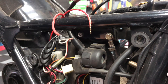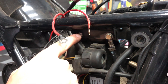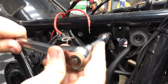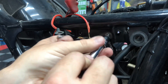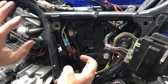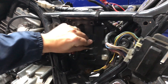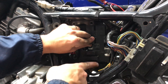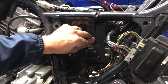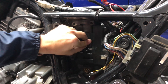Here's what the other side of the battery box looks like. There's this grounding cable here and then there's a Phillips head — regardless, they're both 10mm, so let's remove those. There's actually no need to remove the battery box; you can just keep it in the frame as is. All we have to do is remove those mounting screws to be able to shimmy the battery box left and right, because there are two bolts holding in the regulator down at the bottom. Go from underneath the motorcycle and shimmy the battery box left and right to get clearance to remove those bolts.